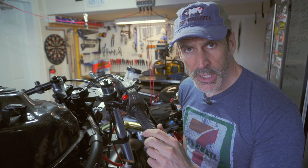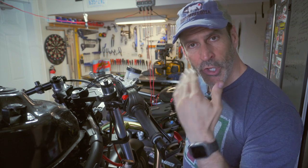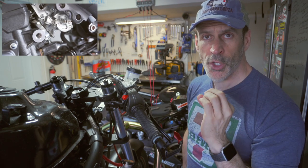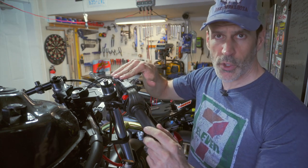We'll slide the boot back on with the protective cover. To validate that your installation was successful, open up your throttle to full throttle and when you release it you should hear that knocking sound where the cam hits the stopping plate on the other side. Do it a few times, make sure nothing gets stuck, and verify on the other side that everything is working properly. If there's no extra slack in the cables — if you don't hear that clicking sound or if the throttle won't open fully — you can use your adjusters to adjust everything properly. That's it folks, that's the process to install the Northern Racing soft pull throttle return spring. If you have any questions please post them below, smash that like button, and as usual stay safe, ride safe, and we'll see you soon.